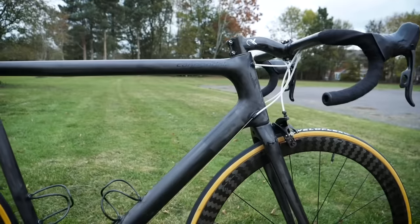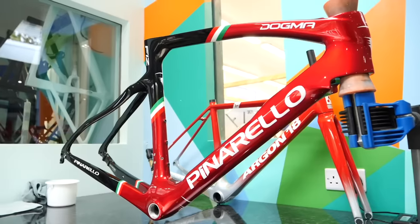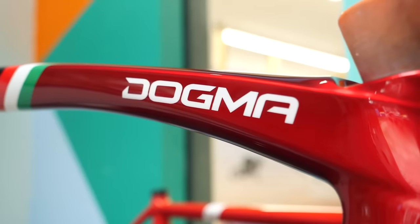My favorite way to reduce weight from a bike is to take off the paint. Paint, primer, and lacquer weigh a surprising amount — typically around 200 to 300 grams, sometimes even more. There are a number of ways you can go about removing your paint. You can do it yourself — just sit on the sofa in front of the TV with some wet and dry paper, rubbing away. Just be careful not to go too far and through the carbon fiber itself. Alternatively, you can get a professional, someone like Ali from Fat Creations, who routinely takes off the paint on frames before repainting them — but you don't need him to paint it after, just take the paint off.